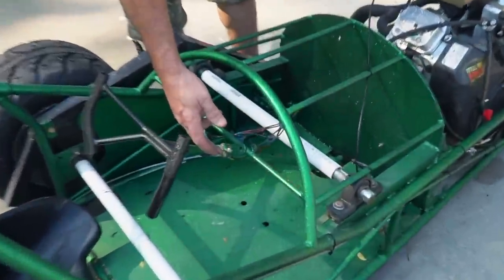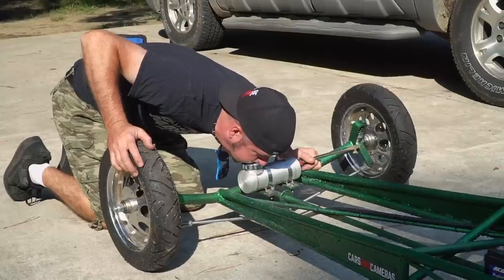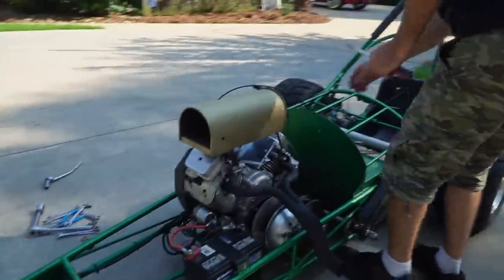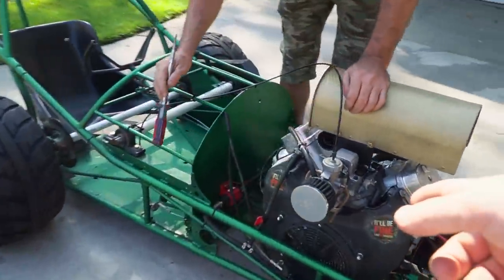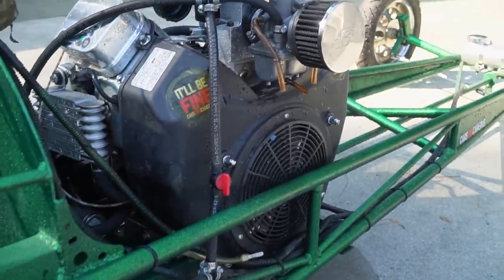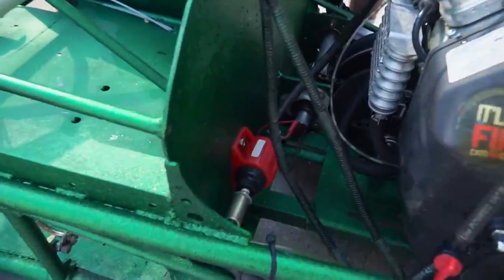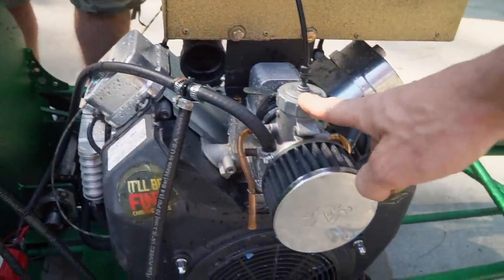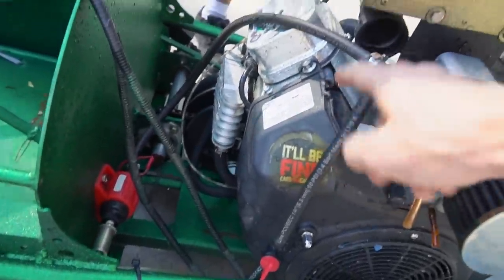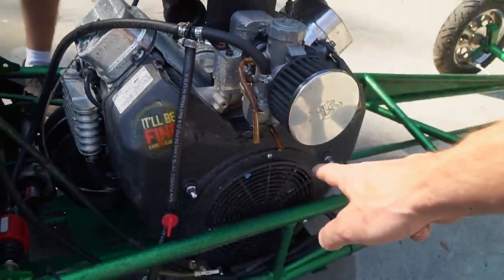Fuel pump? Yeah. I can hear it working — just need a little extra help. Oh, were we losing fuel? Yes, because — the valve is on. For new viewers who may not know this build: our fuel pump is pumping at a pressure rate that overpowers the float bowls in the carburetor, so it'll just push fuel out the overflow. We had to come up with a janky return line that we can adjust with this fuel cutoff. But it's wide open and we're still getting fuel pouring out.